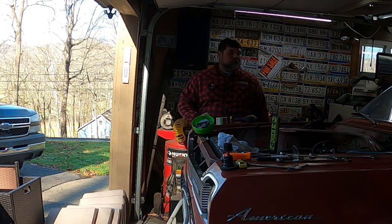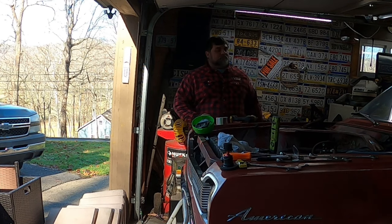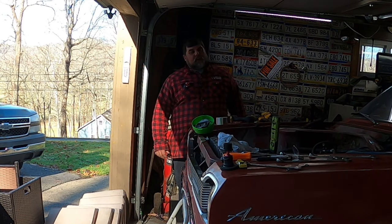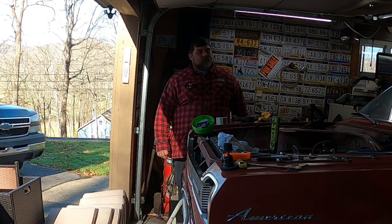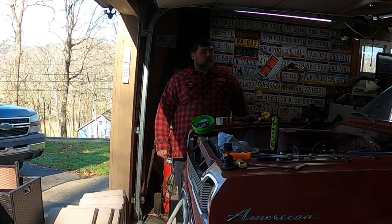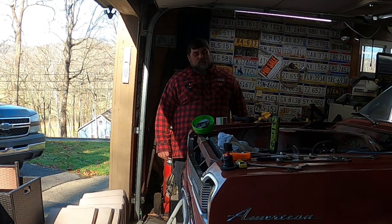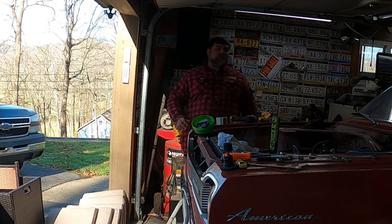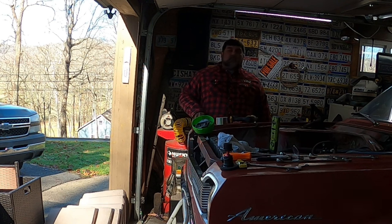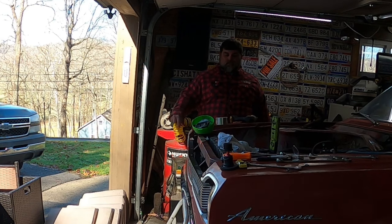Welcome to Anthony's Cross Thread Garage. Today we're going down the boring road of working on this car again and trying to get it right. The carburetor is still leaking — I made a gasket, it leaked; bought a gasket, it leaked; bought another half-assed carb rebuild kit. I'm going to try to put an accelerator pump, gasket, and another gasket on the bowl, fool with the needle and seat on the floats. I've got wheel cylinders for the back, more brakes, and some exhaust I'd like to get welded on. I want this thing on the ground today.